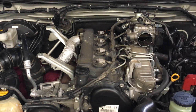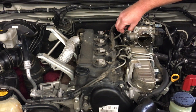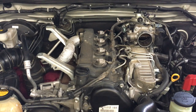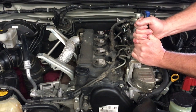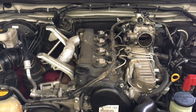Let's see if we get the throttle body off and have a look. This could be called 'removing the intercooler' or 'checking your EGR.' Undo that plug. I'm going to grab a 12mm. I don't think it's going to come undone with the impact driver because it may not have been removed before. Two nuts at the top — crack those loose.